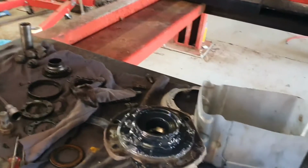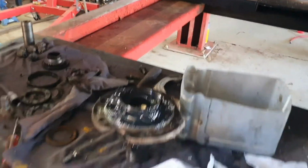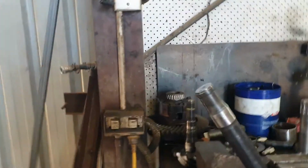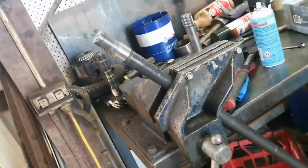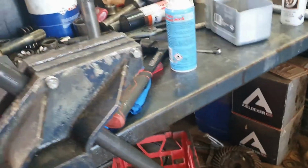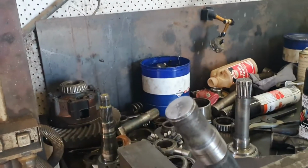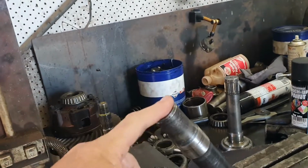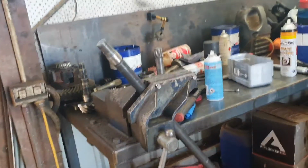Now, if I go over to my axle, I'll find the CV. Now, it's not actually your CV that breaks. As you can see there, that's the axle. The bottom end down there goes into the diff. This up here is the part that broke. It was actually the axle breaks inside the CV. You can see where that is there. And I'll just have to find it. The mechanic's gone out for a little bit, so I may have to join a video onto this. And oh, there it is.